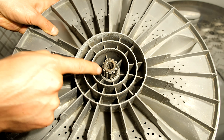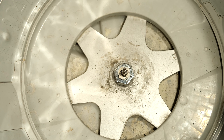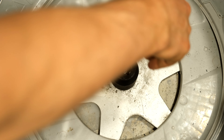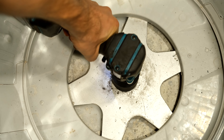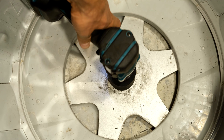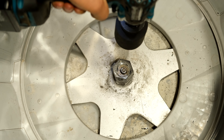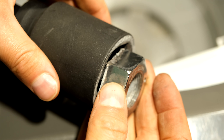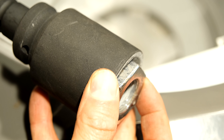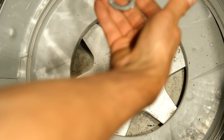If you do slot that in, know that it's going to be quite a mission to get it out — you would have to hit it from this side and tap it out. Now you can go ahead and remove the tub nut. This is a 38mm — I recommend you use an impact wrench. The tub nut is very hard to get out without one; that sheer pulsating knocking action allows you to get this nut off. There's a little washer here — got the washer out.